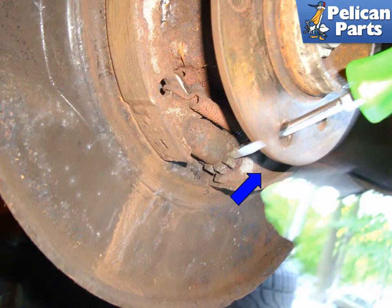Release the lever then pull up three notches. Check that the rear wheels do not rotate and the parking brake warning light is on. When done, reinstall the parking brake lever and the rear wheels and put the car back on the ground.